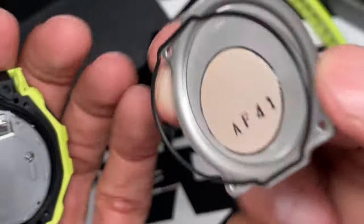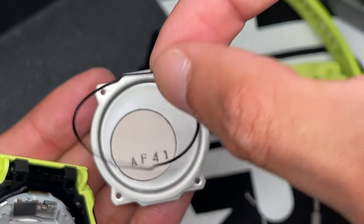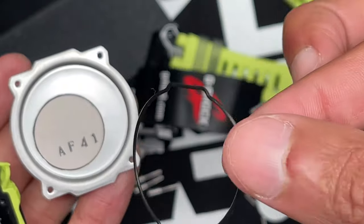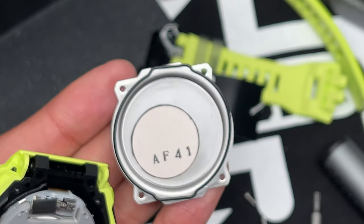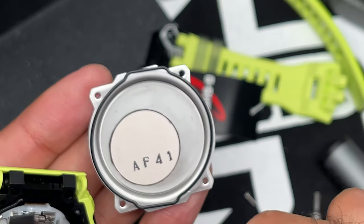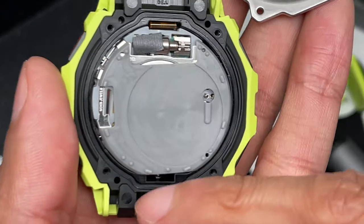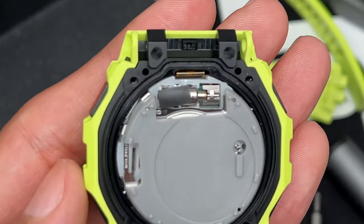There you go. And you have your standard ring. It's not an O-ring, but it is a ring, and it's got that nice shape on the edges to conform to the design of the actual module. So don't lose that. Please don't forget to put that back. Usually it gets attached to here. When you remove it, don't just reattach it there, because it can get bit by the casing. So you want to take this off and realign it with the actual crevice there. It's got a gap around the edge of the module. You want to make sure that it's reattached just by placing it in position.